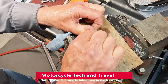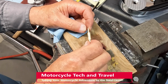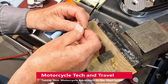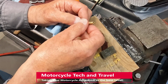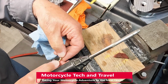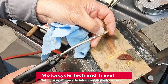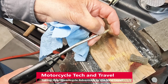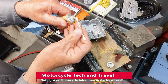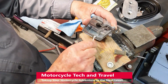Polishing the outside of the nozzle is strictly cosmetic, but helpful. This particular air nozzle is ideal for this kind of work, in this case, reverse blowing the nozzle. The orifice is tiny, yet this works really well. Autosol is a polish, but not too abrasive. Here I polish the nozzle tapered seat as well as the seat for the check valve.